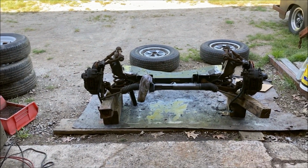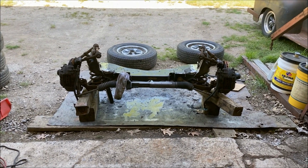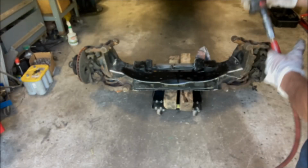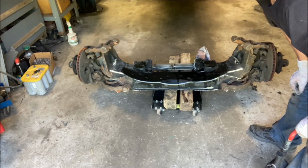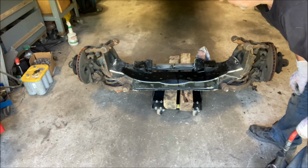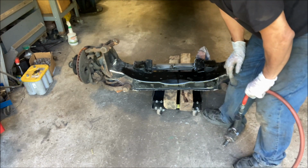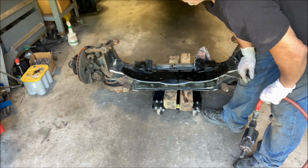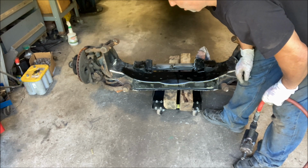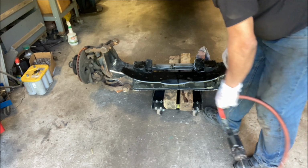All right, I'm going to move that in here and see what happens when I tighten those rods down. If the spring explodes or if it works. Springs are compressed just enough to get the tension off the upper control arms. Only issue I see is this one. This rotated, might be in the way of the frame rail. But as long as I can get it up into the car, and if I can reattach the upper control arm while it's in the car, then I can just undo that and be done with it.